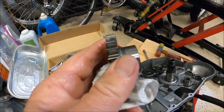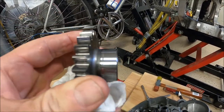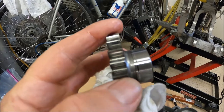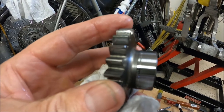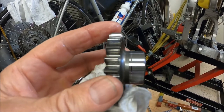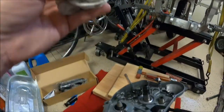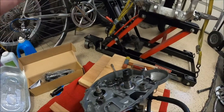It's off. What I noticed is a little shiny ring on the shaft where the drive gear sits — that's from the crank seal. I can just barely feel that with my fingernail, and your fingernail can usually detect anywhere from about one to two thousandths. So that wear groove from the crank seal is maybe a thousandth of an inch. What I'll do is take some very fine sandpaper — like a thousand grit — and just polish that up and get it smooth again. This is a low-hour engine, so all these seals and bearings are relatively fresh.